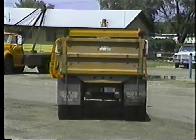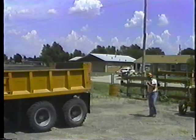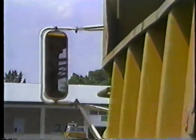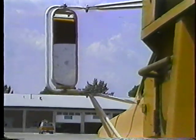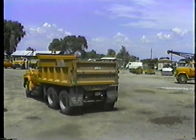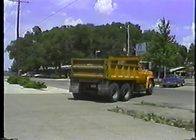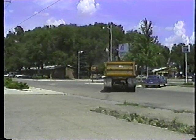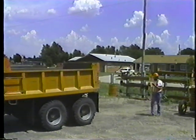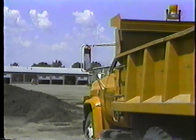Pick out reference points that you can back toward and keep them in sight in your rear-view mirrors. Even better, ask someone to spot for you and follow their directions as you back up. Use your mirrors — don't lean out of the cab, as that's a good way to lose control. Always back up at a safe, slow speed so you can stop quickly if needed. Back up only when you have to; if you can drive around the block to avoid it, do that.